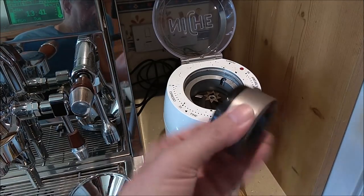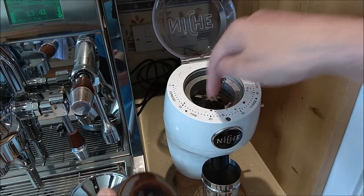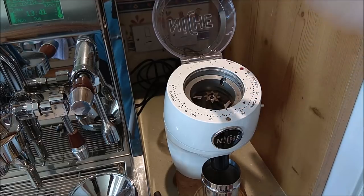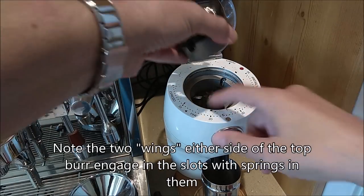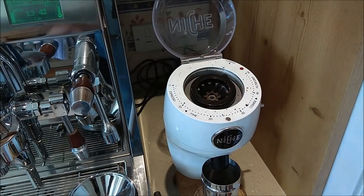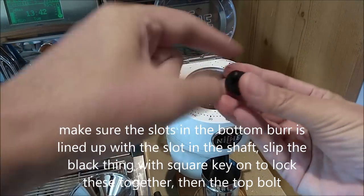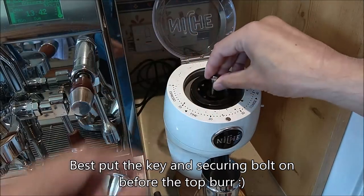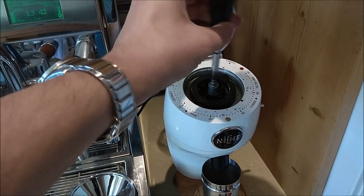I've brushed the cutting surfaces of the burrs down. I've brushed the cutting surfaces and given the bottom a light brush, and the same on the lower burr — I haven't removed it or touched the sweep arms. Removal of the lower burr is simply lifting it straight off the shaft — it's loose — and just dropping it straight back on. The shaft centres the lower burr and it's a nice tight fit. Drop it back making sure the springs are in place and check it moves freely. Then the bolt and keyway — drop the keyway in and that locks onto the centre burr.